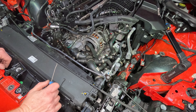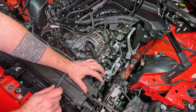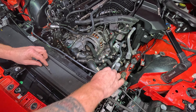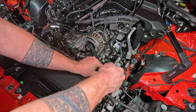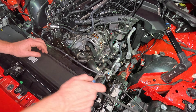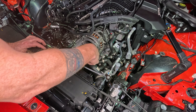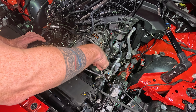Now that all that's off, we're going to start pulling some hoses. You've got your overflow radiator hose right here. If your car is new, this shouldn't be fragile, but keep in mind older cars — it's going to be really fragile. All of these hoses have the same kind of horseshoe clips where you hook underneath and pull up on the clip, and then it should work its way right off. Sometimes it can be really tight. Work this off and pull it out of its clips, then you can bend it up and set it aside. Next, pull your top radiator hose — there's a horseshoe clip here, but start with the smaller ones first. Pull the clips on both of the smaller ones, detach the top, detach the bottom, and go ahead and pull out your top radiator hose.